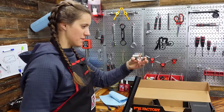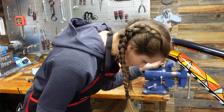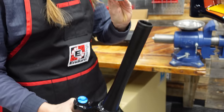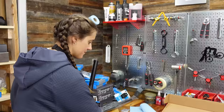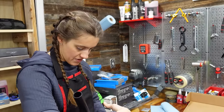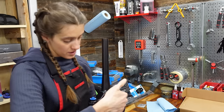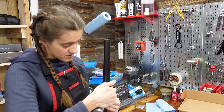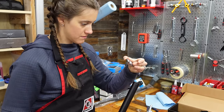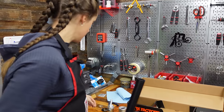One side is up and one is down, but they look the same. It fits on this tapered part of the crown race. So the big picture: put this all in, put the stem on, put the spacers I want on, then mark where we want to cut the fork, and then we'll cut the steer tube. Given that, it might be worth not doing grease yet — too late. But I wouldn't grease anything else, because as you cut it, metal shards end up stuck to the grease.